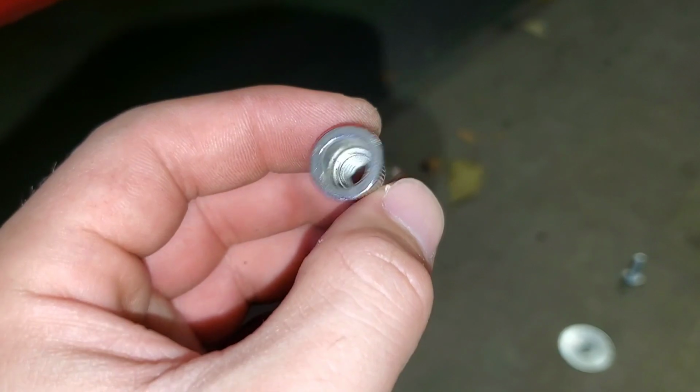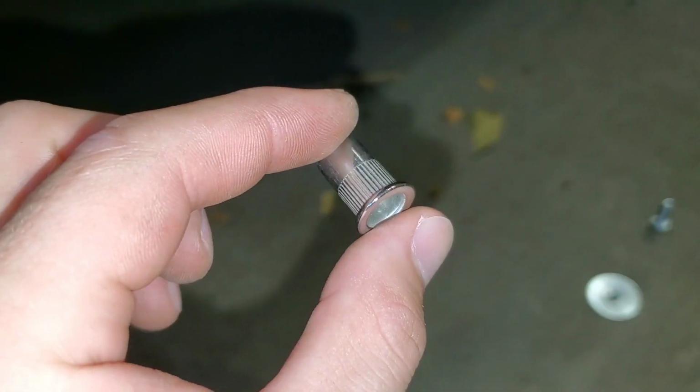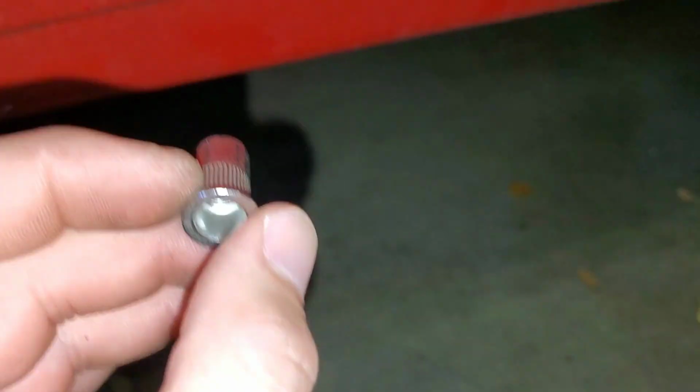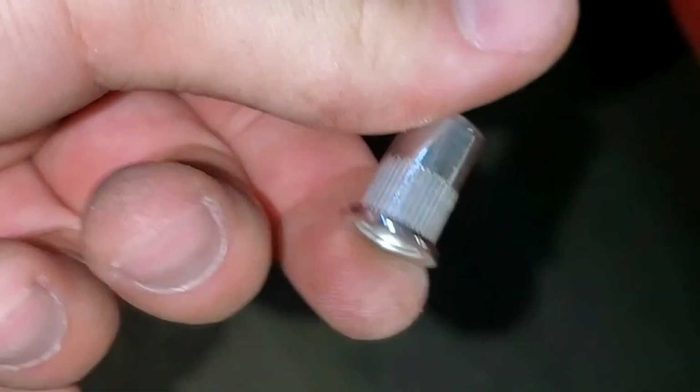So this is what a Rivnut looks like. It's basically just a rivet with threads inside, but this is what it looks like before it's installed. So what happens is you put this in whatever hole you want to install this into. This hole is too small, but these are sold in all kinds of different thread pitches and sizes, dimensions, but I found this size to work perfectly for the holes that are underneath the side skirt. I will include a link in the description for these. I got these from Amazon, and I'll also provide the part number for these clips on the side so that you can replace those if needed.